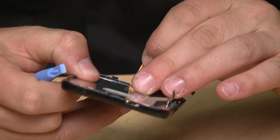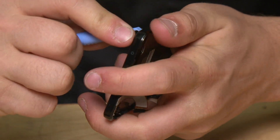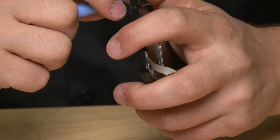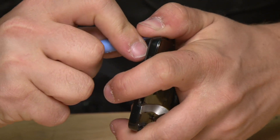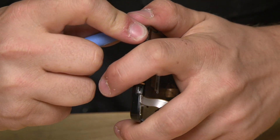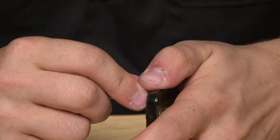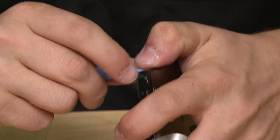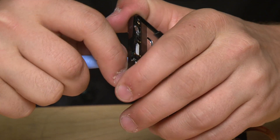This ribbon cable we need to pry off — it's just glued down to the LCD. Now that that's loose, there's adhesive gluing the glass all the way around. You could use a hairdryer to heat it up. I've already disassembled this so it's going to come a little bit easier. I'm going to start prying this up using a plastic tool to get in between the glass and the LCD, and once you get in there you just want to go very slowly and pry your way around.